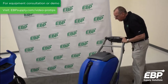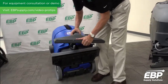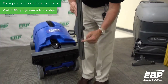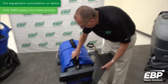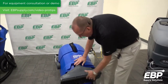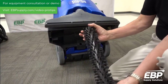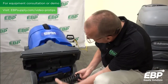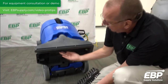On the self-contained unit there are extra maintenance steps that are very critical. Push the lever, the head comes off, and you want to make sure all the way across the vacuum shoe it's nice and clear. If there are stones, hair, or debris, you need to clear that after every single use. Also, the brush on this machine just pops right out — if you don't rinse it off there could be hair or carpet strings on it. Clean the brush after every use, and also clean up inside under the carpet extractor or you'll pass debris on to the next job.